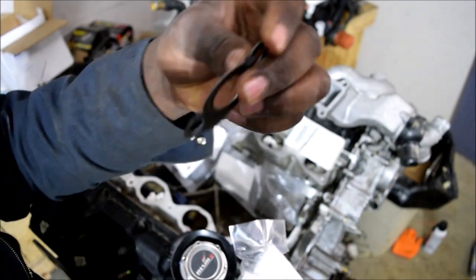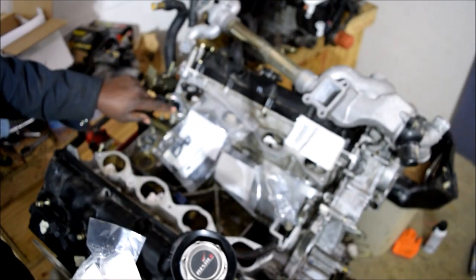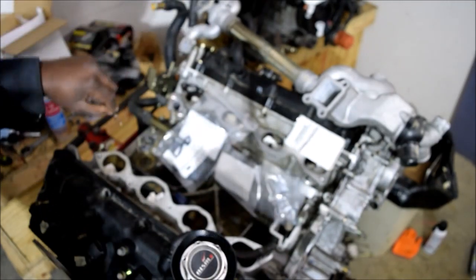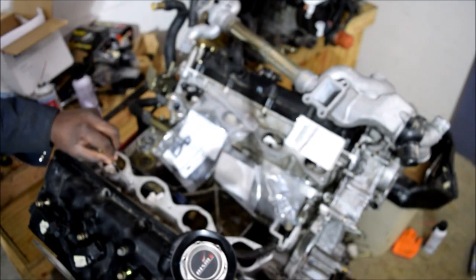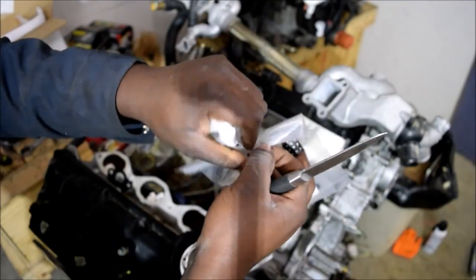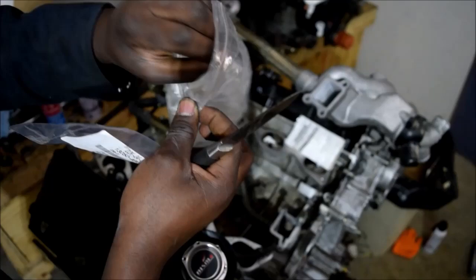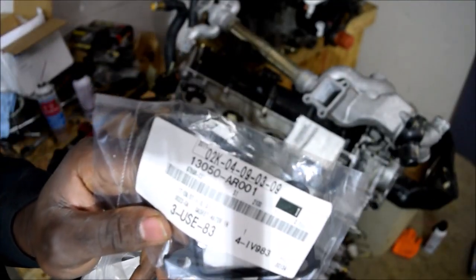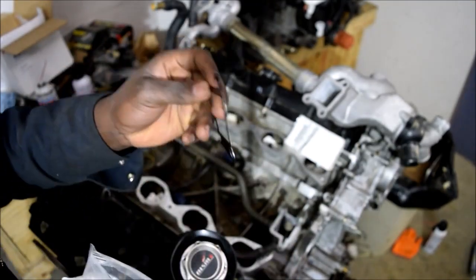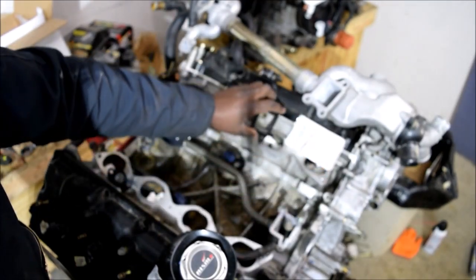These ones have hasps. So these go over here and I'll get them there when the time is right, once I remove the bolts. Here's the second one — this one goes to the other side. There's a second part over here. So I'm throwing these away. And here's the third one — or fourth, depending on how you want to look at it. One O-ring and three gaskets. This one here is 13050AR001. This one also has those claws that keep it located when you move your tube around. And this one goes right there.